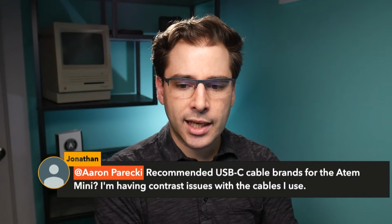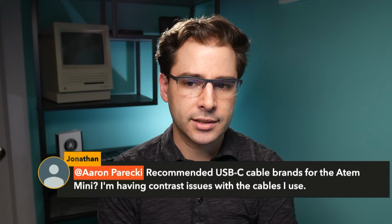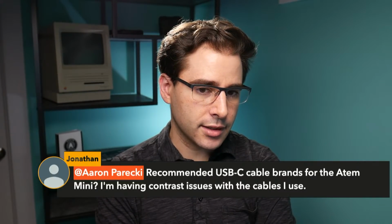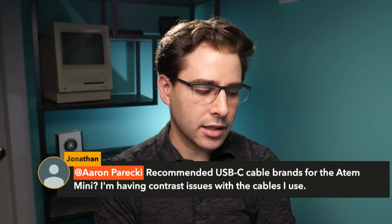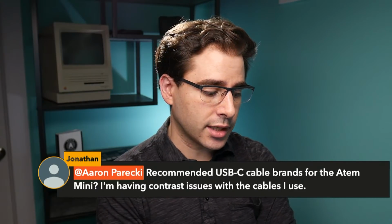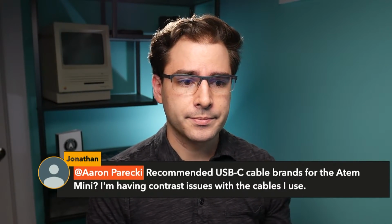Jonathan says, recommended USB-C cable brands for the ATEM Mini. I'm having contrast issues with the cables I use. I don't think the cables are going to determine the contrast issues, because it's just data going through it. I will say the thing that the cables have affected for me is latency, I guess, or just having it not work. So it is only USB 2, so you don't need the fancy Thunderbolt cables, but the shorter cables I've had better luck with. But I don't think I've noticed any differences in the contrast, because it's a digital signal at the end of the day.